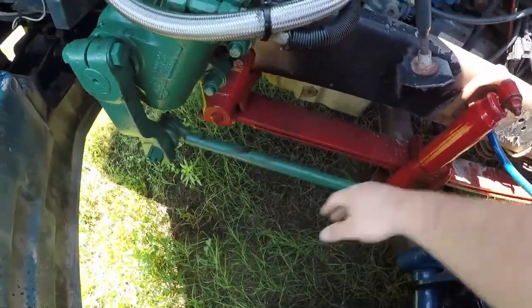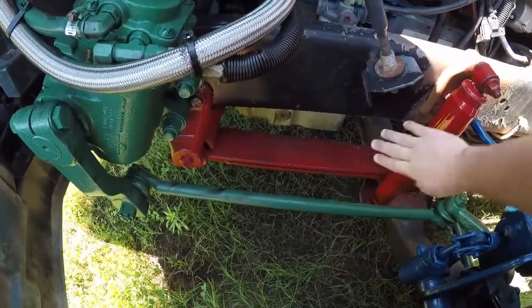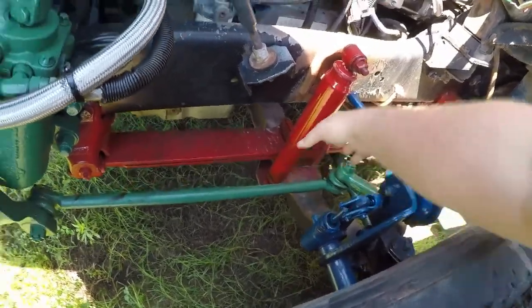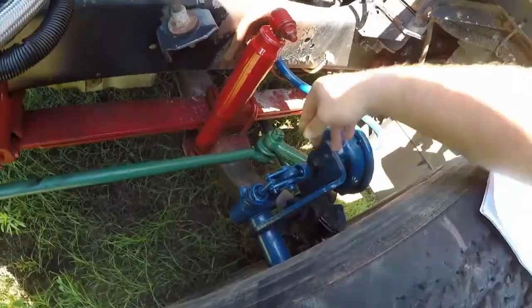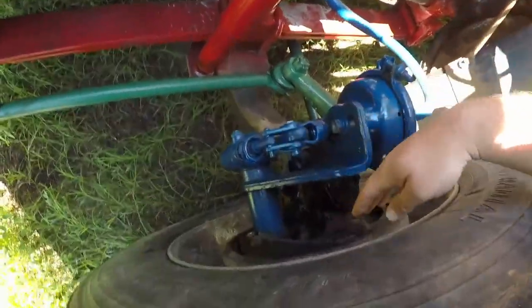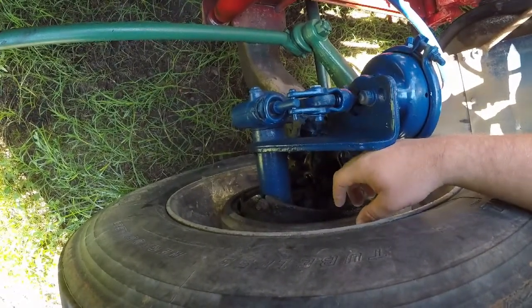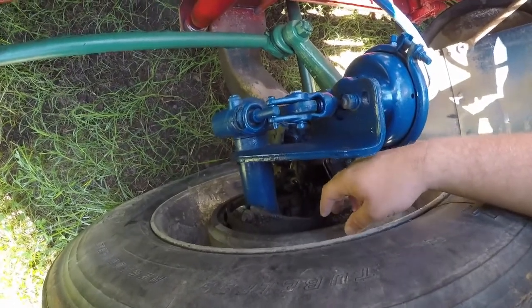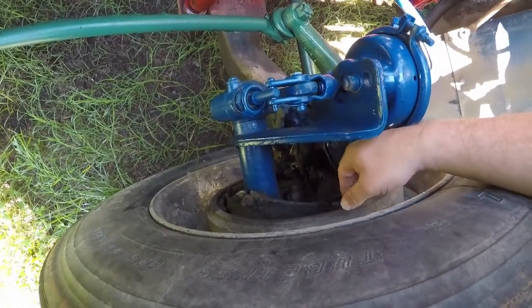Be sure all my bolts are connected like they need to. Check my spring mount and my springs. I'm going to check my suspension and make sure that looks fine. I'm going to actually follow that over from the brake line to the braking chamber. I'm going to check my slack adjuster and push rod. And there I actually want to be checking, I think it's called the brake shoe, brake hub or pad. No, yeah, that's it. Braking pad. Be sure you got about 1/4 inch on that.